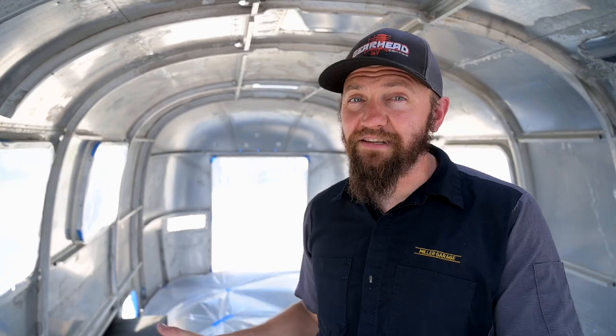What's going on everybody? It is Ian here with Miller Garage. Today we are back out in the motorcycle hauler Airstream and we are going to be working on insulation. In general when it comes to Airstreams we tend to err on the side of keeping it simple. It's very easy to spend a lot of time and money trying to insulate something and only gaining maybe half to one R-value in thermal efficiency, so we really try to keep it simple. We use effective insulation that fills all the space and we don't overthink it.